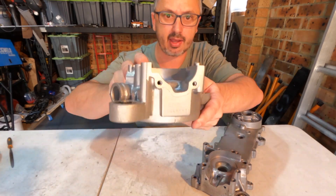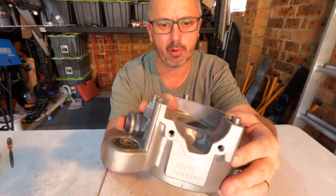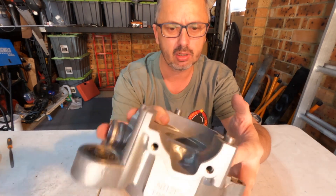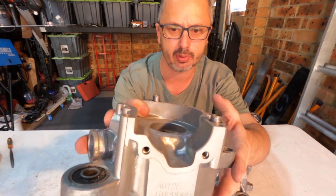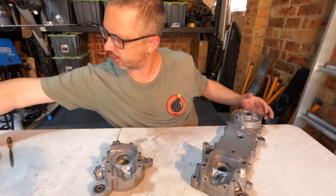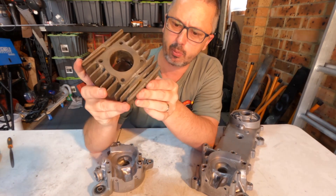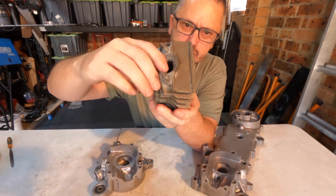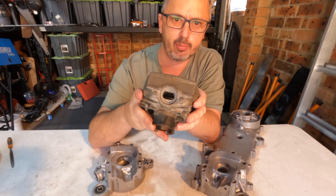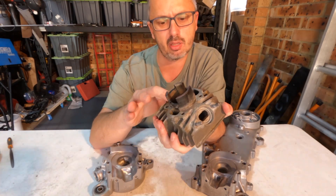The small part of the case is now finished too — all polished up, looking perfectly good. I haven't gone too overboard on the polishing, just probably about 240 grit. I can get it to a mirror polish but I don't think that's necessary. From here we're going to move on to the cast iron cylinder. I did have this sandblasted as well. We're going to do a little bit of work mainly on the exhaust side — that looks like a mighty restriction just there, so we're going to open that up so we can at least port match it with the exhaust.